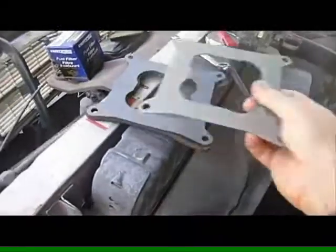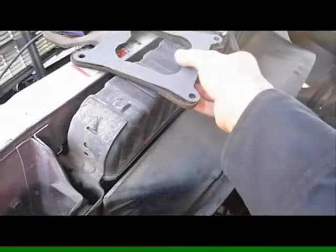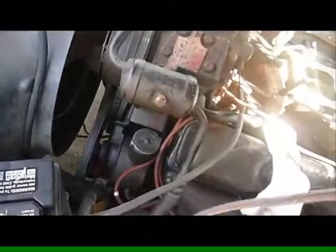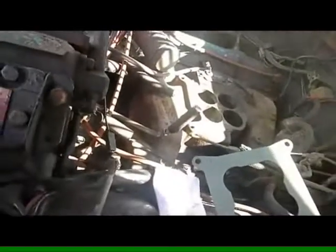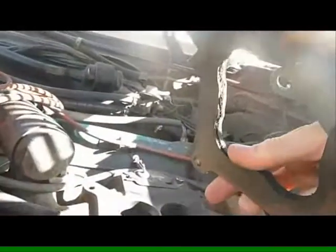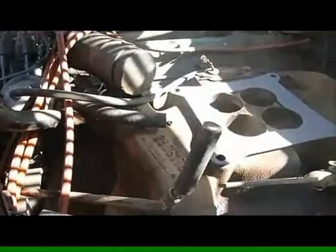We have some new gaskets — we're going to use that thick insulated gasket, but we have a couple to put on to the base as well. We do not have a new thick spacer, so we're gonna use some small ones to help take up some slack. Follow the pattern and try to put it on the way it came off. You can see the pattern of this fits on like this, so you want to make sure this goes on the right way so you can follow set patterns underneath. We're gonna put on one of our base gaskets, angle it the proper way, and then we'll make our sandwich with this piece.